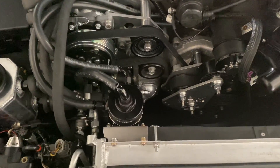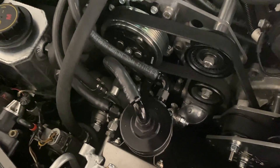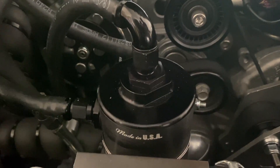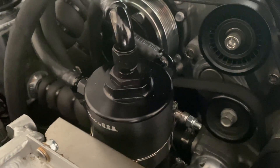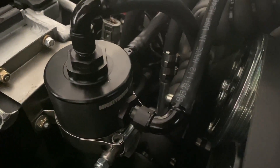Today's runs are to check out the work we did this past week and make sure that oil leak was stopped. I do have a Mighty Mouse catch can on this vehicle — you need a catch can to keep oil out of the intake track. In a supercharger, that oil tends to clog up the intercooler that's in the hat. Making sure the air separator keeps all that out is super critical. The catch can seems to be working and vacating crankcase pressures. We'll take all the data captured on HP Tuners and go from there — if you're running a higher performance vehicle and you're not running HP Tuners, that's a mistake.